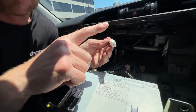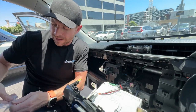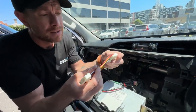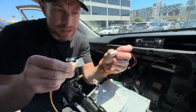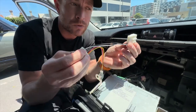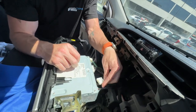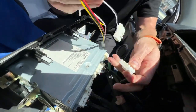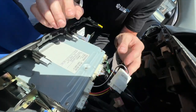Now that you've mounted and run the camera from back to front and pulled the stereo out, the cable is routed behind the stereo as a four-pin plug — this is the specific Toyota bracket camera with the Toyota plug. Take the 24-pin camera adapter — for anyone without a camera on the vehicle this is what you need for 2014 through to 2020 with this style radio, and the silver ones on the dash are the same. It's a T-piece harness with a four-pin plug that the camera plugs into. Plug the camera in first, then this section plugs into the radio. The two additional wires retain the speedo information on the speedo cluster. Unplug the existing 24-pin white plug on the back of the radio, plug in the new T-piece harness, then plug that back into the radio.